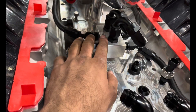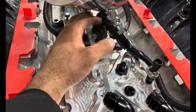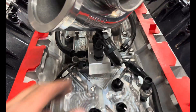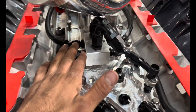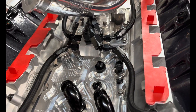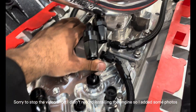For those asking, we machined the block with two divided ports so you can feed and return off either side. The way I'm doing it: two dash-eight lines run up, feed through the front runs out forward, and returns out of the back with a banjo-style fitting on the back to clear the up pipes on both sides. The lines are heat sleeved to keep them tight and I'll p-clamp them all the way around. With a normal oil cooler this block definitely will not work — you'd eat the turbo from how much higher they sit. This is something we make in-house; I came up with the design and me and the boss machined it.